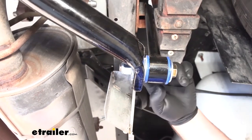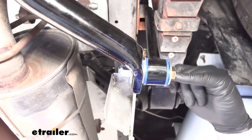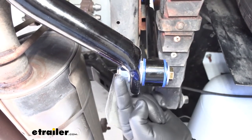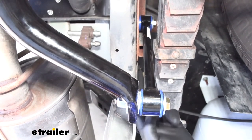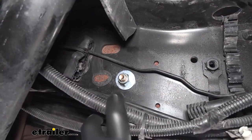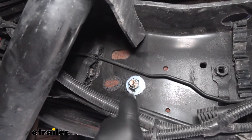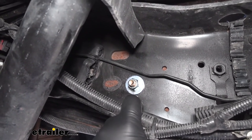Before you tighten your end link onto your bar, make sure the bolt head is on the outside. Then go flat washer on the inside, bolt through the bar, flat washer, and then nut. Once you have your hole drilled, use that same combination going through the frame rail. On your driver's side inside frame rail, you're going to have a couple of hard lines. I would suggest popping the little plastic holders off and flattening them down against the bottom of the frame rail when you drill your hole, so you don't make contact with them and cause any damage.